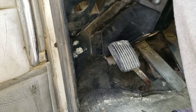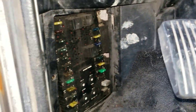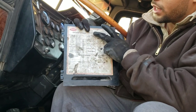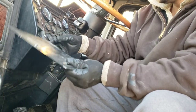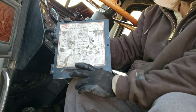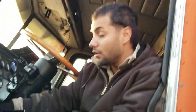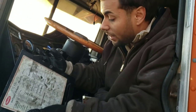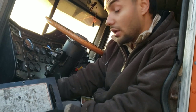Try to find your fuse box. Typically on your older Petes and Kenworths it's gonna be sticking right up in here. A lot of times, if you're fortunate enough to have a fuse box cover, it'll tell you what all the circuits are and the ratings — 20 amps, 50 amps, whatnot. Unfortunately, this is the factory fuse box panel cover, but this is more than likely not the original fuse box. So none of the labeling on the cover is going to be matching.